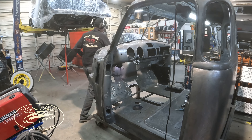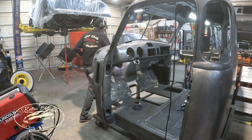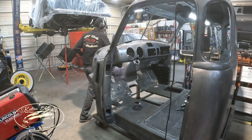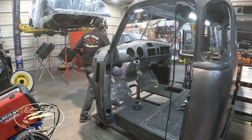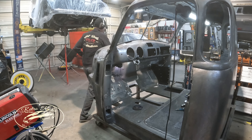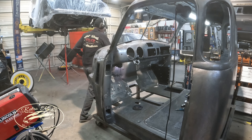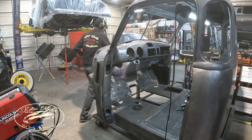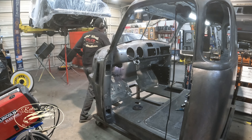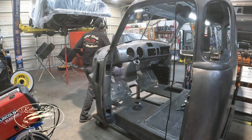What are you replacing here? So what we're going to do is cutting out a whole floor board and a toe board to one piece. But I have to separate the A-pillar from the top of the floor and this inner panel here. And I'm just curious about if we need to do some bracing across this B-pillar to the A-pillar so this doesn't shift.